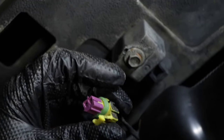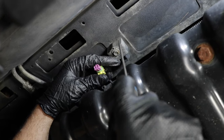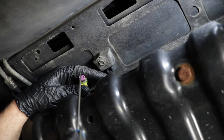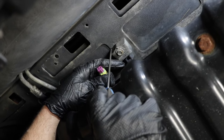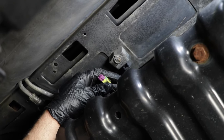If you had a code for just one sensor — if it was a right sensor or a left sensor — you can normally switch them, then re-hook up the battery and test-check your code to see if your code moved. If it did move, you know that was the bad sensor. In our case, we just have one, so we just need to replace the sensor.